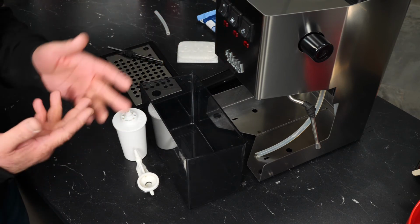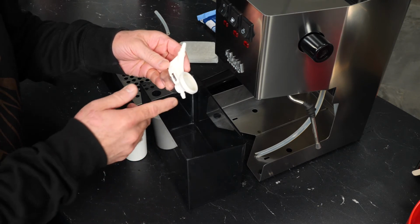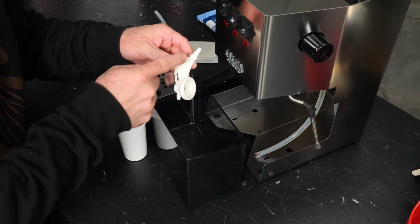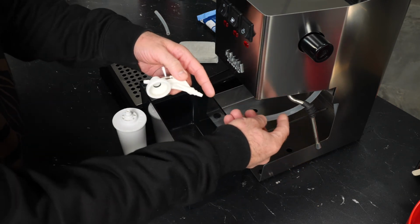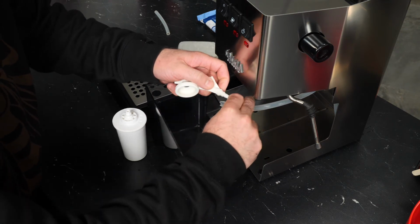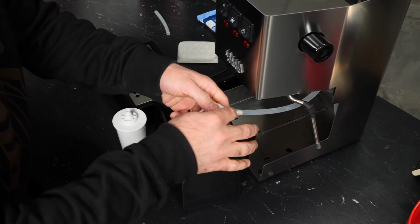So that's going to involve taking your water adapter and then connecting that to your water inlet. Now you do need to be able to identify which of these two ends to connect the inlet to. In the case of the Bestcup adapter from BWT, it's going to be this one that's angling outward. The water inlet is the longer of the two tubes that hangs in the reservoir, and it has the sort of forked tongue end on here. So simply go ahead and secure that onto the intake from the filter.